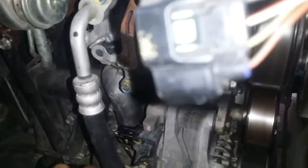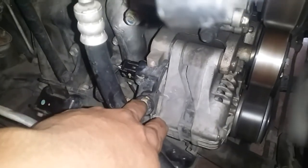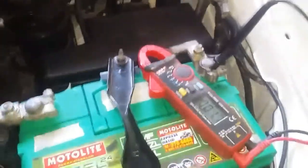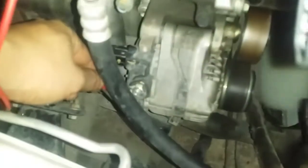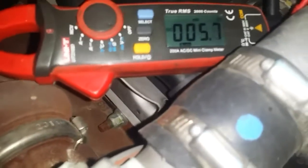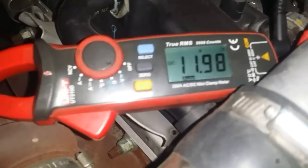Now we'll make sure if our alternator is not really putting out any battery voltage. We're going to remove this cover. This right here is called the B+ post of the alternator — this is connected towards your battery via fuse. I'm going to leave the negative probe on the negative terminal of the battery and stick the other probe here, and then we'll check the reading. We are getting a reading of 11.9 volts, so basically our alternator is not really putting out anything.